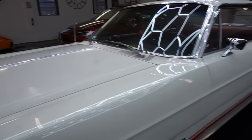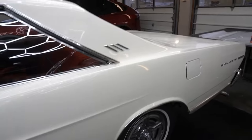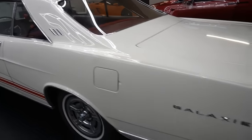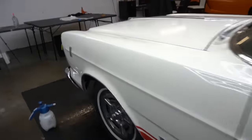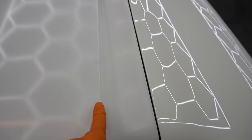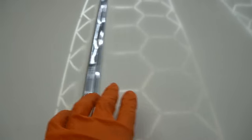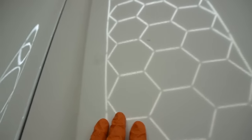We have some areas where the paint is original, some where it's been repaired and resprayed. A lot of the paint is oxidized, which happens to single stage rather quickly and easily. We can correct that and make things look a little more even throughout each panel. The popular way that in my area we've been bringing these back is to, well, not do a respray and just save the paint and the material that's already there.